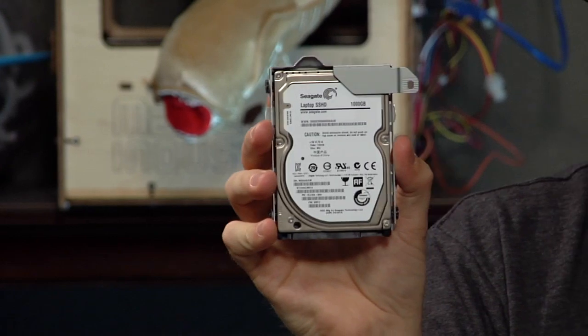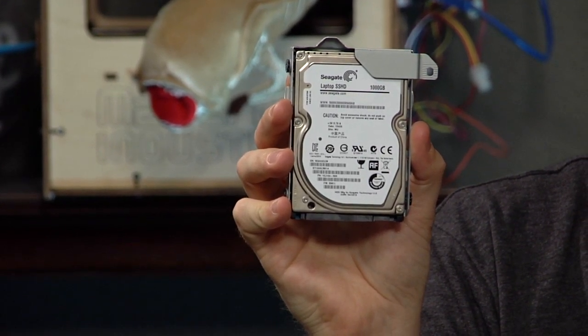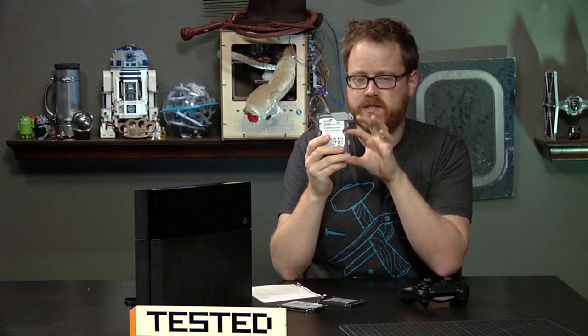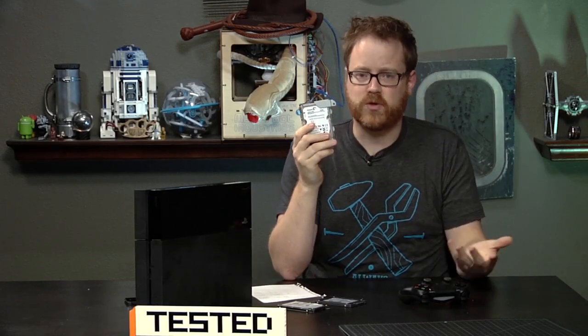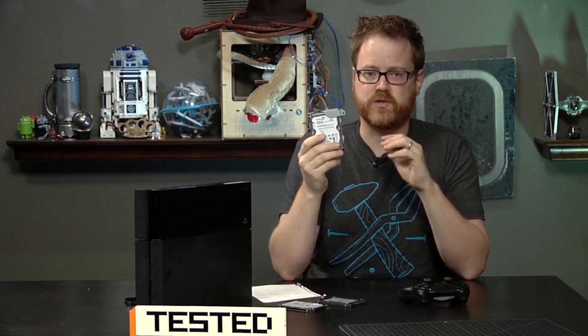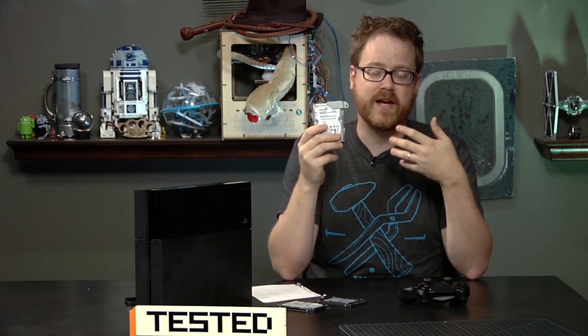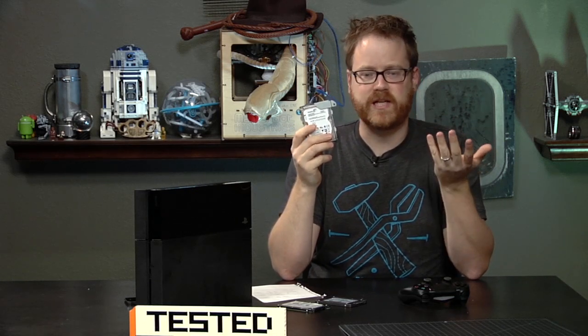However, there's a third option on the performance front too. It's a Seagate hybrid drive — it's part normal hard drive, part SSD. The way this works is really straightforward. There is a spinning disc on it just like any normal hard drive, but there's also a relatively large amount of flash memory on the drive, which the drive can use to cache important stuff that you access frequently. On a Windows machine, it keeps Windows and your most frequently used apps like your browser in there, and it just kind of happens magically in the background. The drive is smart enough to know which parts get used frequently and saves them in the flash memory.